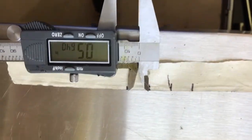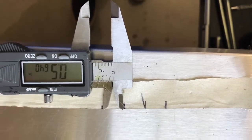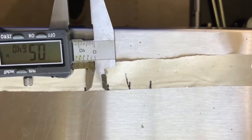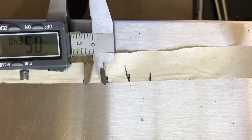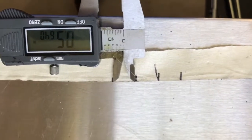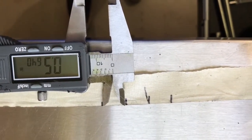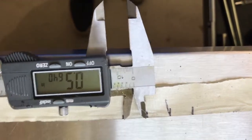Next I'm going to show you some basics on tuning the engine now that we have it running. My balancer had good marks for where 10, 20, and 30 degrees were, but it was really hard to tell what top dead center actually was when the thing's turning around for timing it, and no marks beyond 30. So I got the distance between those marks, copied that to find top dead center, then divided that 10-degree span by 10 and multiplied by 6 to make a mark for 6 degrees. I have timing tape on the balancer so it follows a curve, then I'll transfer marks for 12 degrees and 36 degrees onto the balancer.